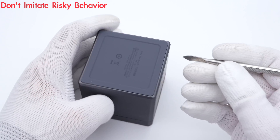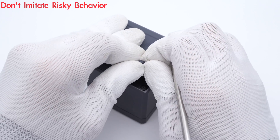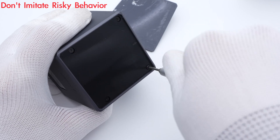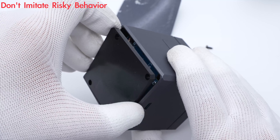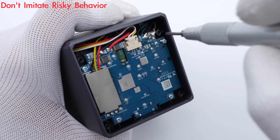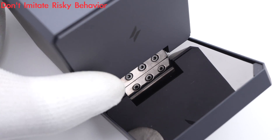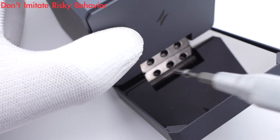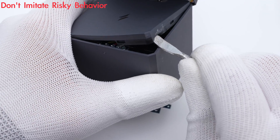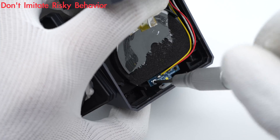You can place it vertically or horizontally, which is very suitable for the standby mode of iOS 17. After a brief introduction, let's take it apart from the bottom. Turn with the rubber pad and remove the fixing screws. The main PCB is fixed with screws. Then remove the hinge. Use the spudger to remove the wireless charging panel of the AirPods, and remove the small PCB of the LED light.